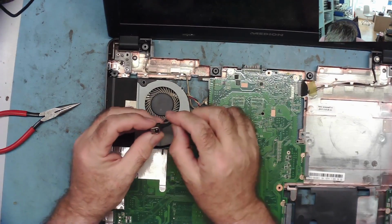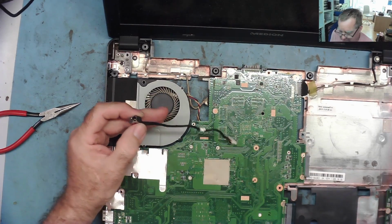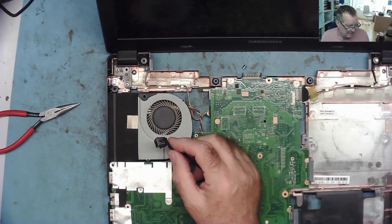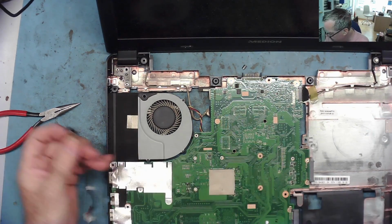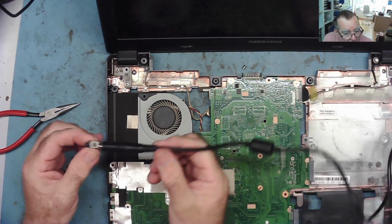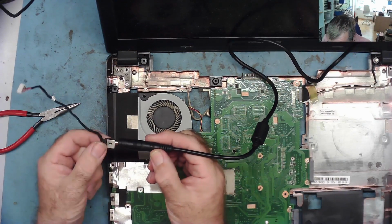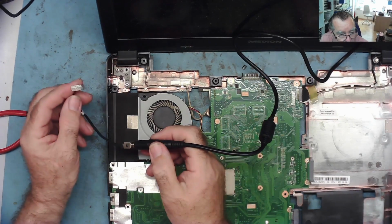All right, so we have the power cable off. Let's see if this is actually faulty. Because I'm thinking now maybe the whole thing was just moving. It's not mounted on the motherboard. It fits into a little place here. And I may well have to ask him to bring the power supply in. I mean, it did seem stable enough when it was on. So we can connect my power supply. Yeah, and that's solid. So we don't have a problem as the customer described with the power socket. What we actually have is a problem with this power supply.